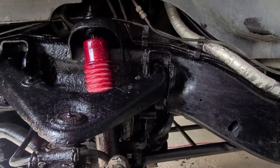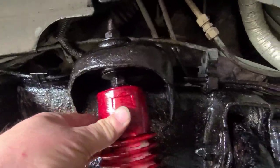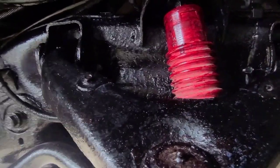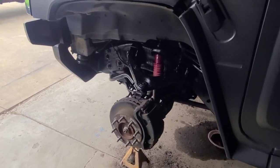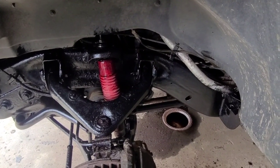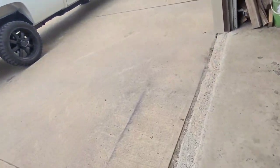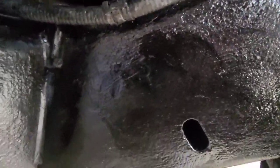Another recommendation: if you have the time, pull out your shocks and things like that. You can see where I got it on the plastic — I'll probably run some lacquer thinner over it to get it off. Use a one-inch, two-inch, and three-inch paintbrush. If you're going to do inside and outside over two days like I am, make sure you have two sets of brushes and plenty of rubber gloves — throw on a fresh pair for each coat. We'll walk around to the other side and you can see it came out just as nice. This is three heavy coats, not just a light application.